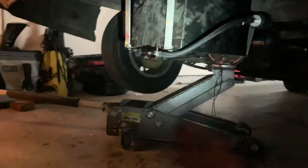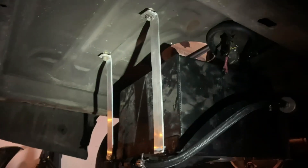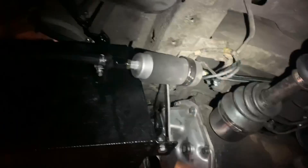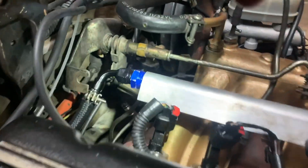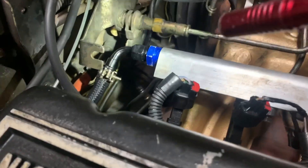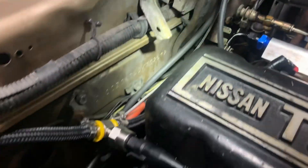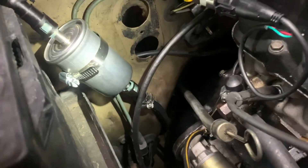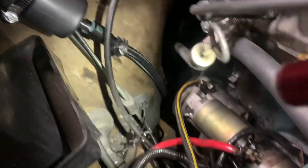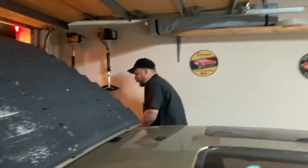It's been a long night but we got the fuel system all plumbed up, the hose ran. We made these nifty little brackets out of aluminum, all TIG welded, to support the cell. Got everything from the tank up — there's a 90-degree fitting back here, the return is now on top with a little loop hose. We got an adapter to 6AN fitting off the rail going behind the valve cover to our fuel pressure sensor, and a new fuel filter with quick connects following the same route as the original fuel hoses. Now let's climb in and make sure it doesn't leak.